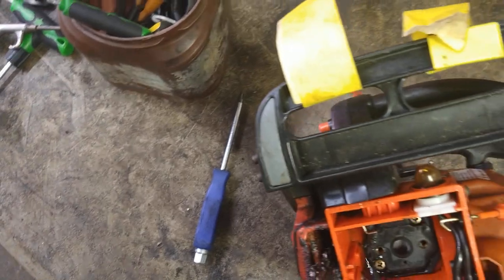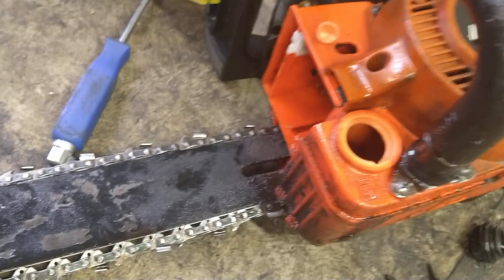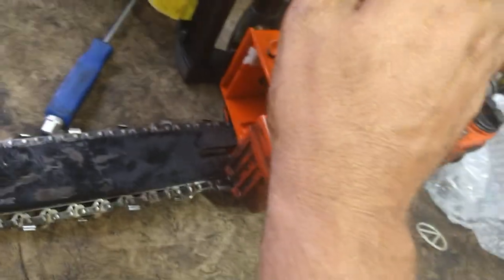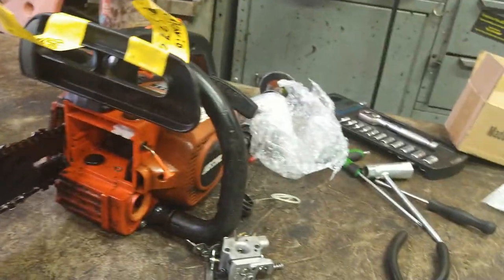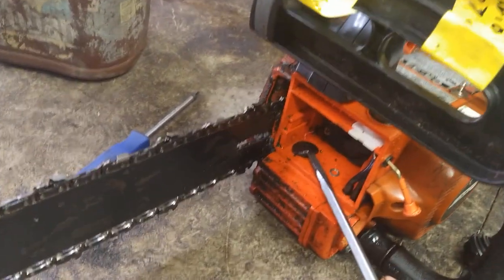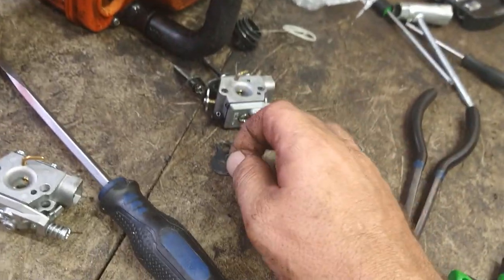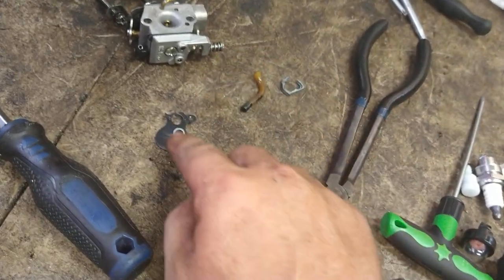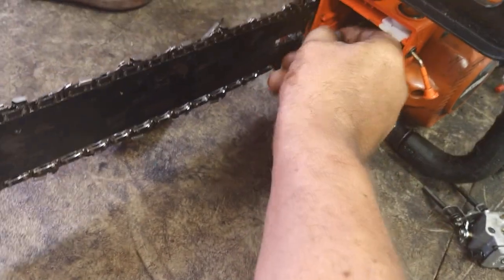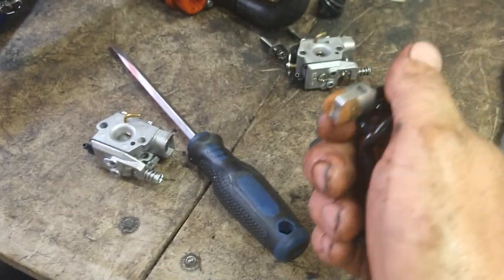So this is the only fuel line here. Let's stop the gas before it starts flowing everywhere. We're going to reach down into the gas tank and grab the fuel line that's in there and pull it out. If you have trouble grabbing it, take a flat head screwdriver and just pop this grommet out — get underneath it and pry it right up.